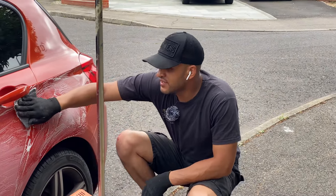I've base-coated the primed area and flicked some colour into the door. All that's left now is just a final drop coat, blending out the base-coated area - coming out this way and flicking up into the quarter panel. We'll wait for that to flash off, mix up the clear coat, then we'll clear coat the final part of the job.